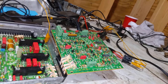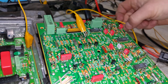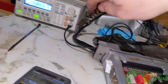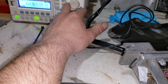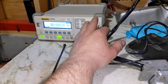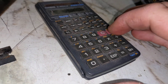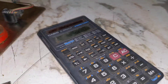What I'm going to do is take this little jump lead and bypass that component right there to see what happens. We have bypassed the rev limit. It does eventually cut off at around 380-something hertz, so I'm going to guess that's over 7,000 RPM. Times 60, divide by 3 — won't really have to worry about that. The valves will be floating by then anyway.